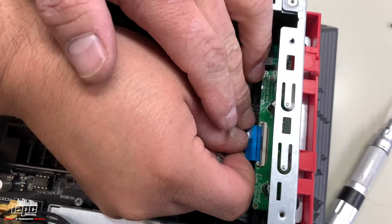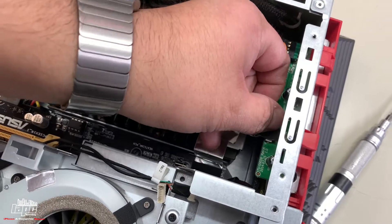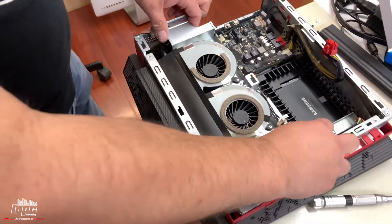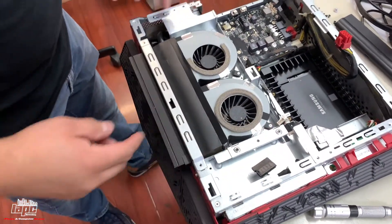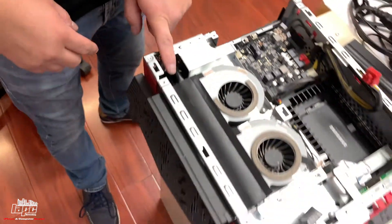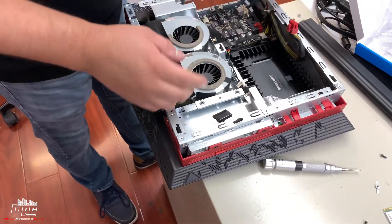Make sure the little tag is facing up, then push it down. We're gonna get our tape — this is flexible tape just to keep the area secure. I mentioned removing those inner screws earlier; that's in case you want to access the RAM, which is right behind there, or if you want to clean your fans — you can do that through there too.